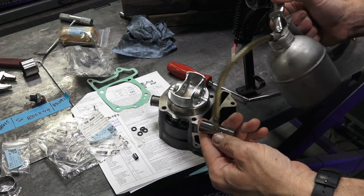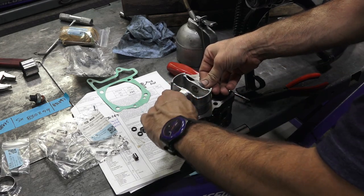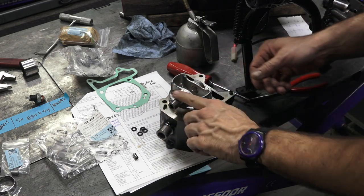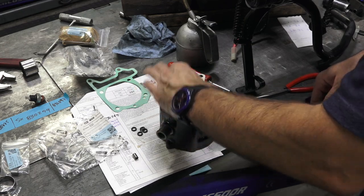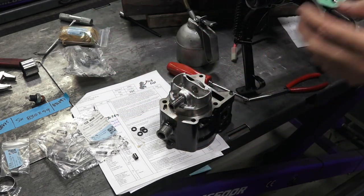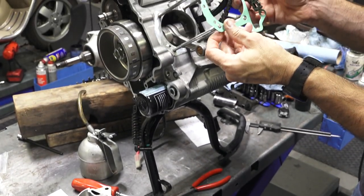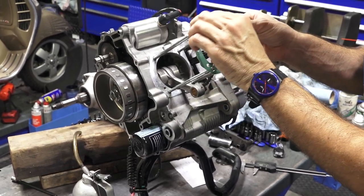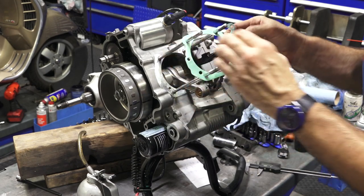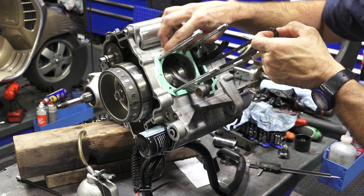All right, so I'm going to take my piston pin, oil it up. And like I suggested, I got the gap on the side where the cam tunnel is, or the clip, excuse me. Take a little bit of the oil, put it on the skirts here. Now the piston's ready to go on. So I take my 0.4 gasket. I'm gonna go back to the engine case. And like I suggested in previous sections, sometimes I would replace these studs. These studs are in perfectly good shape. Piaggio doesn't have any requirement that they need to be replaced on the 200, 150, 300 motors.